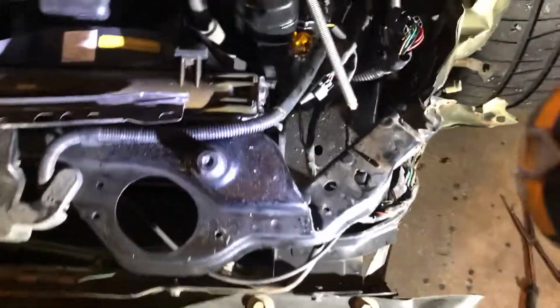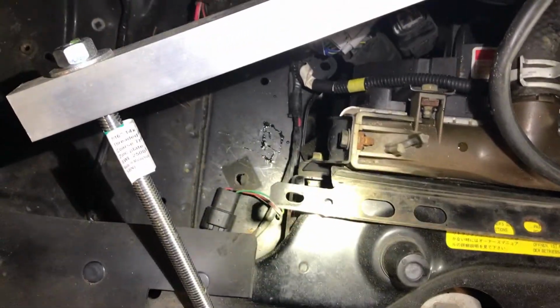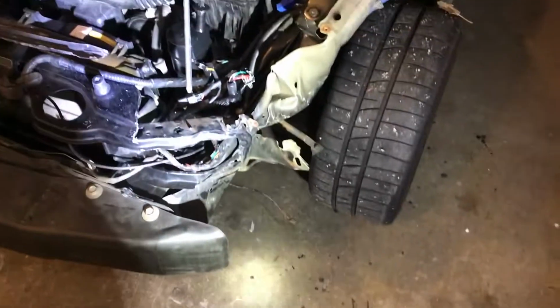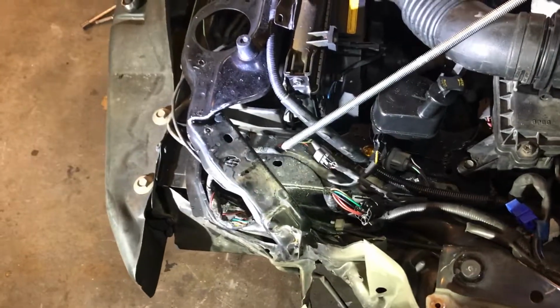All right, you guys, we got some good news. That frame reference hole right next to that wire there, to the one equally on the opposite side here underneath that piece of tape, is exactly within spec. So to me, the accident came in this direction diagonally, boom, hits pretty much right next to that reference hole, and that's still perfectly straight.